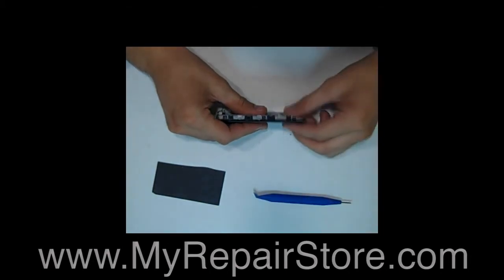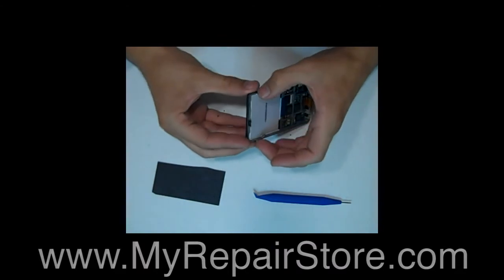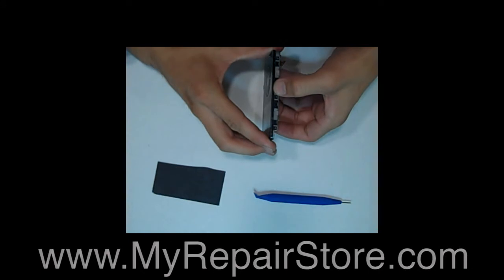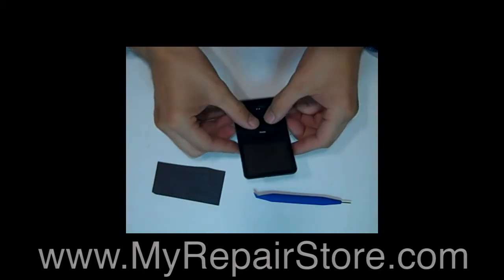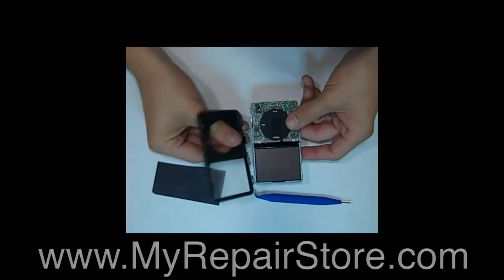After you've removed the 6 screws, the mid frame, meaning this metal piece right here, should just pop away from the faceplate. Go ahead and push on the click wheel and pull back on the faceplate. Sometimes that helps remove them from each other. You can go ahead and set your faceplate aside.